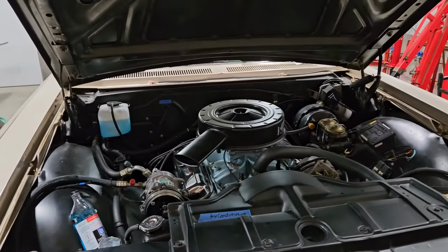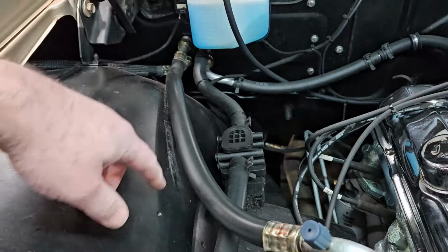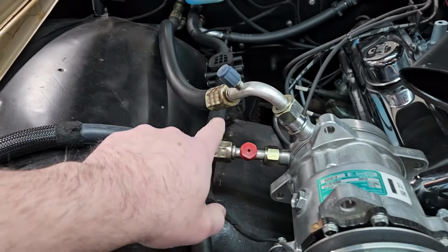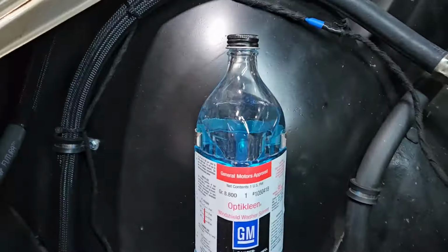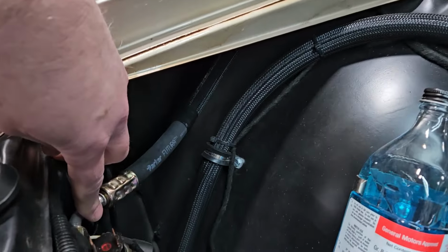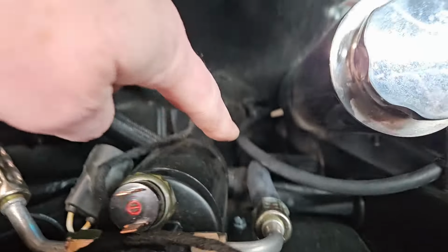Anyway, welcome back. Okay, just notes for myself as I'm going through this. You know, feed, return. So this is the suction line. You can tell because it's large. This is a pressure line because it's small. So just kind of reminding myself where everything loops. See that lower one over there? That comes off of the dryer. This is... okay, so this one is the lower one.